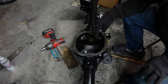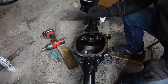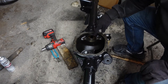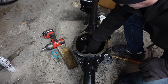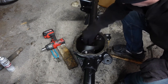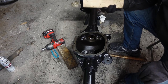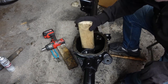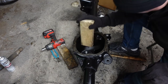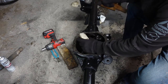Welcome back to doing myself garage. My next step: I've got the bearings pressed on the pinion and everything else assembled on the hub. I need to get the bearing races into the axle. This bearing race for the pinion is just sitting down in here and I'm going to try to walk it in with a 2x4. If I can't get it, I'll go get a driver set, but these came out of here pretty easily.